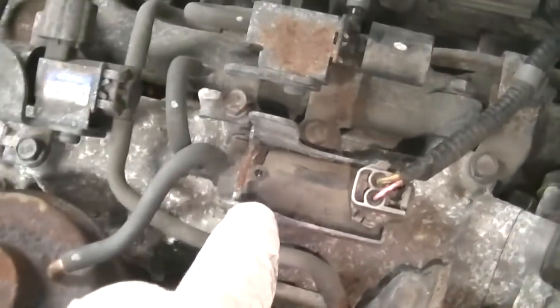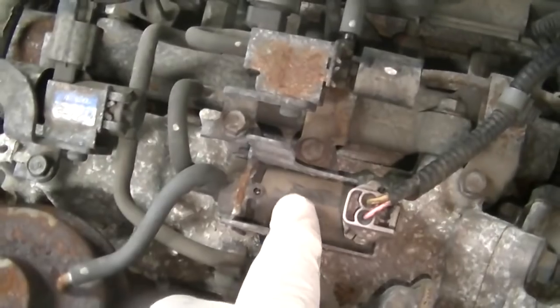This is a bit unusual — it's got two EGRs. From my visual inspection, there's a vacuum solenoid that looks a bit dodgy, and I also end up finding an intake hose with a hole in it. All these things can create codes and hassles.